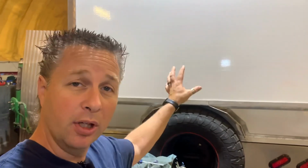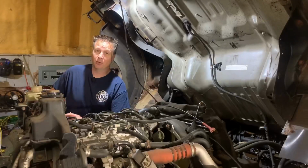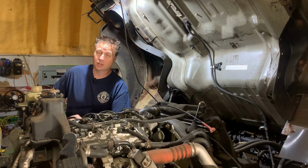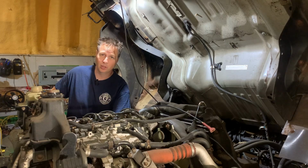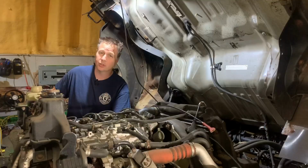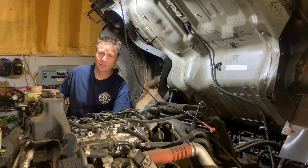For the last couple of months there hasn't really been much building going on because I've been fighting an issue with the engine not starting. And after going through a lot of diagnostics, I'm pretty sure I've chased it down to a failed CP4 fuel pump, which I changed out last week with my spare from this engine. Which means everything downstream needs to be taken out and cleaned.